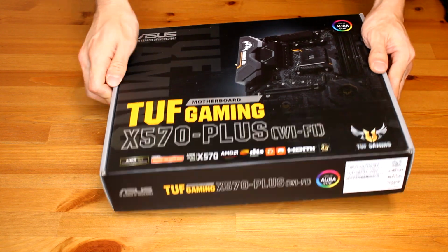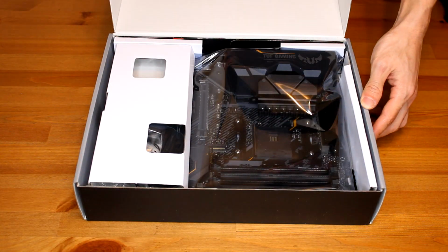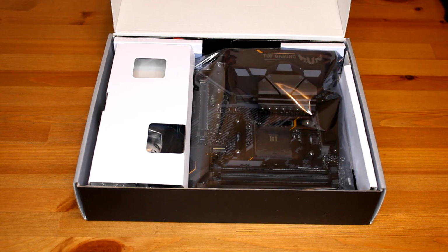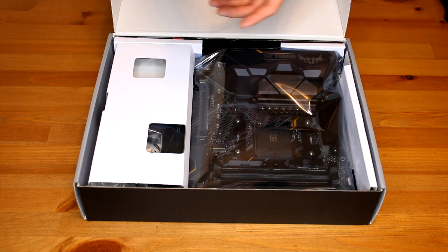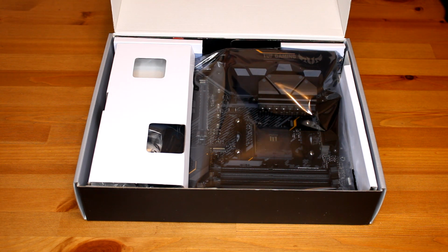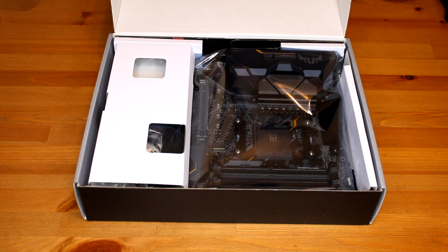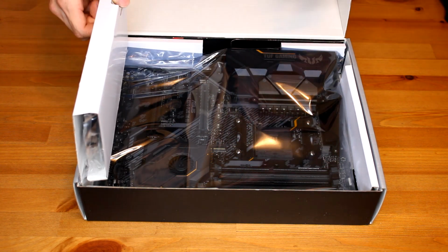Okay, so first off, what you're going to want to start off with is your motherboard. We're just going to open up the box. Again, a cool little trick is if you're worried about static electricity and all that, you can wear the wrist guard. You could have your static pad. You could do that. I'm not advising against it. For me, I've talked to enough people and I've gotten their opinions and suggestions, and a cool little trick is to just touch your PC case and make sure you de-static. But also this bag is an anti-static bag, so just work on top of that.